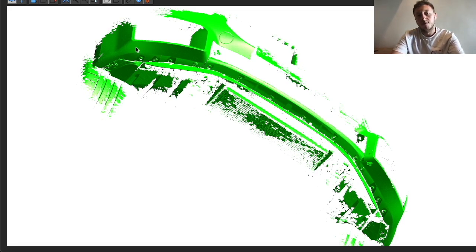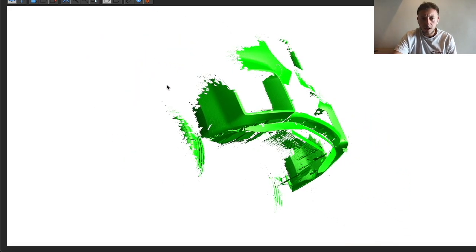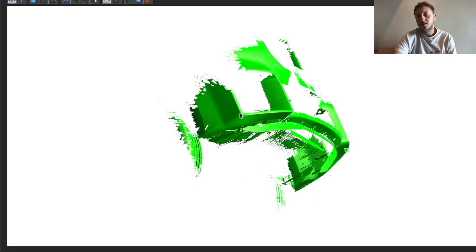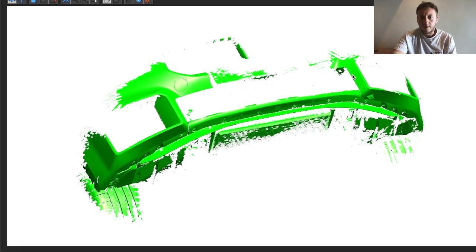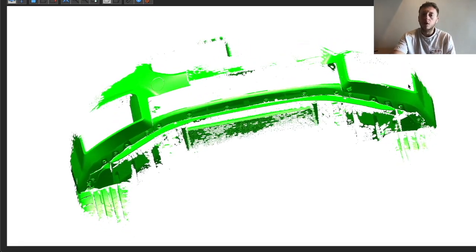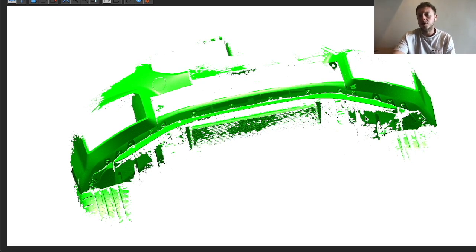We've also got some self-tapping fixings going to be installed here because the distance is just too big. If the car's getting up to speed and some air gets in between this distance, you can look at pulling the side of the front lip down. And then let's have a little look at the bumper design. So there's a nice flat face here, and then it curves back around and then into this big square inlet. You've got some big inlets here, and then there's these two nice air ducts that have some nice shapes, which you'll see in the design. So overall, from a design point of view, it's a really good bumper to work with.